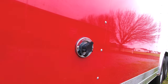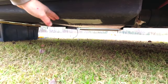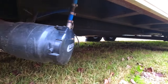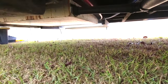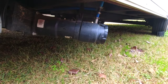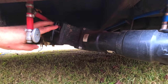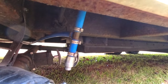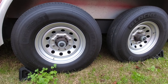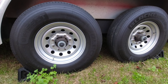This is our fresh water inlet, and underneath is where we have our sewer connections. Here's the black tank — that's 30 gallons. Then we have another tank here: this is our gray tank, also 30 gallons, and it connects to what was a spare tire holder that we sealed off — that's another 30 gallons. So for gray water you have 60 gallons total. You have your standard dump valve here with black tank on one side and gray on the other. These are your low-point drains for your hot and cold water. We mounted these Black Lion 14-ply tires about a year ago and they have been outstanding. The axles are eight-lug.